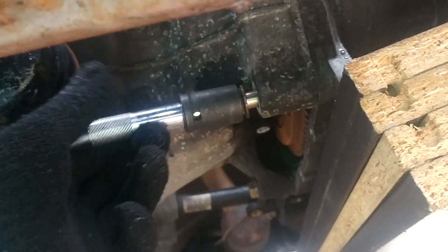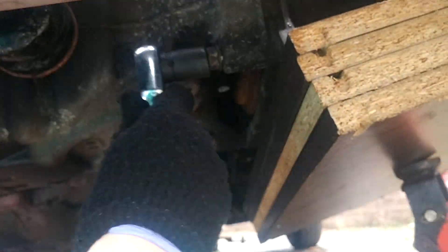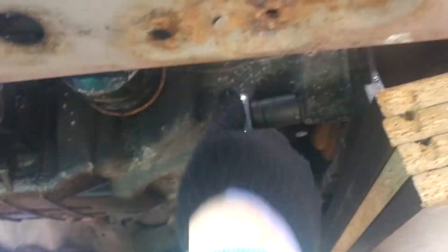The sun made this very difficult to film, but we're going to put the bolts in hand tight first and then tighten with the breaker bar - four on the back and one at the front, with the final one being with the starter motor. I'm quickly getting most bolts in just to confirm the gearbox is in the right position, then going around for final tightening. The plate cover for the flywheel has also been fitted and everything's been tightened off camera.